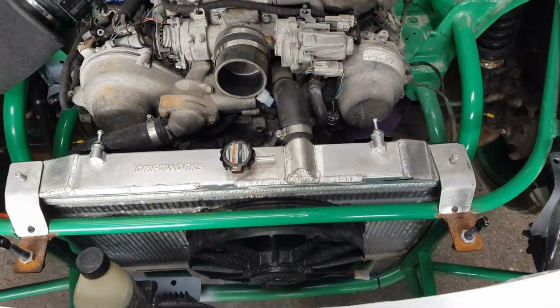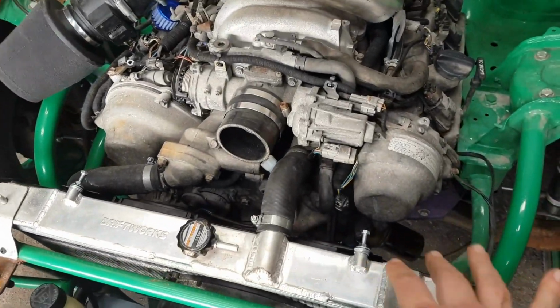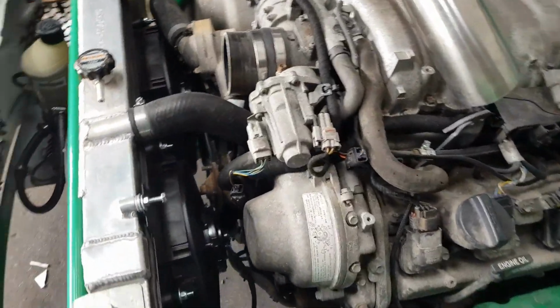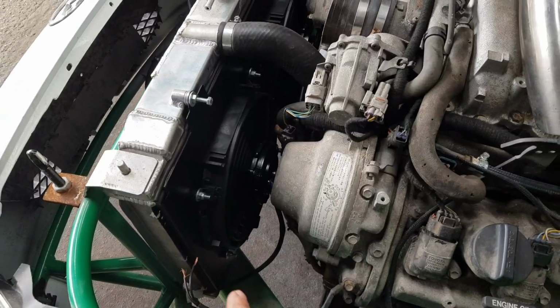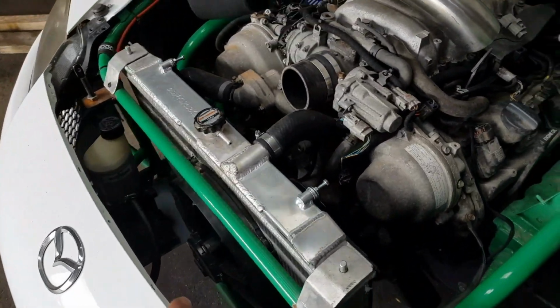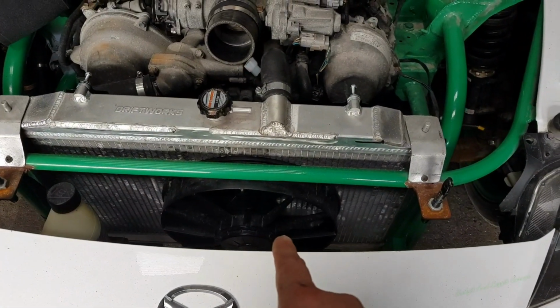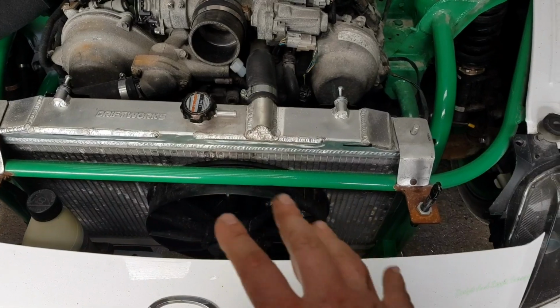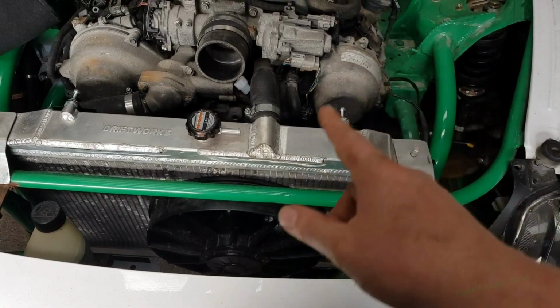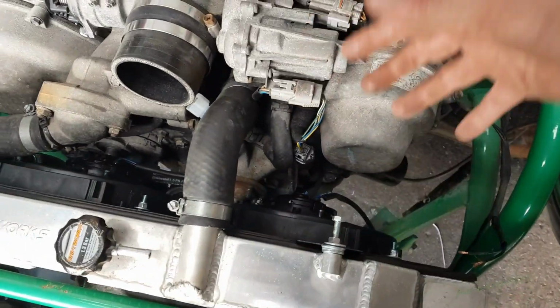Hello and welcome to another Budget and Leggit video. This video is going to be wiring my new fans, because in the last video we made this radiator shroud and fitted the two new fans. There was a 12-inch fan fitted before and it's fitted wrong. I don't like it. It's pulling the air that way. It's not great. You want the draw of the fans to work.